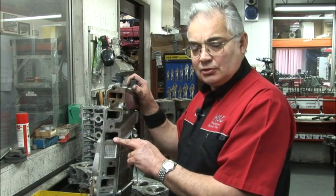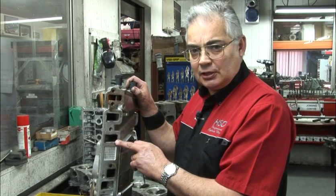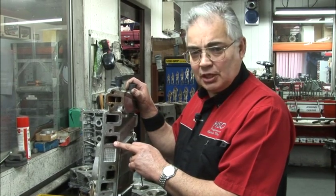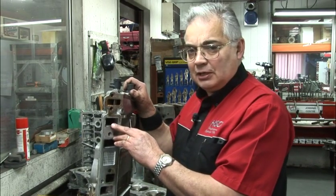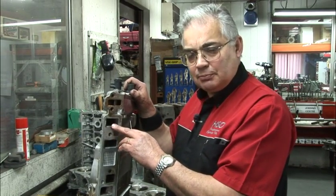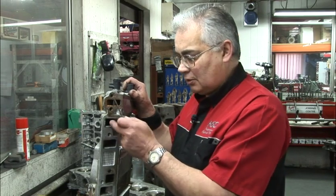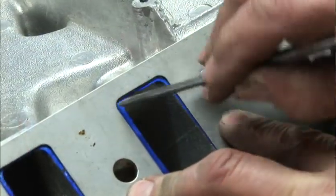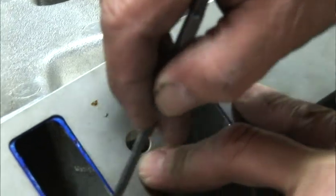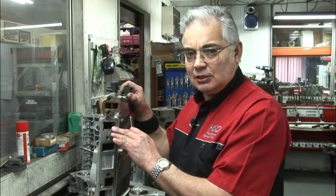Because of manufacturer's specifications and tolerances, the intake port on a manifold is usually much smaller than the intake port on the cylinder head. This will allow for mismatch and no overlapping of the port. The mismatch is not always a bad thing. That can create an anti-reversion step between the manifold and the cylinder head, thus stopping air-fuel mixtures going back down the manifold on overlap. However, on a race car where you're trying to optimise the airflow as much as you can, you make that inlet port as close to the shape and the size of the intake port on the head as you can.